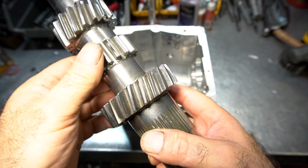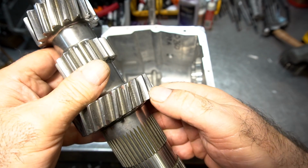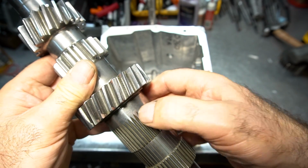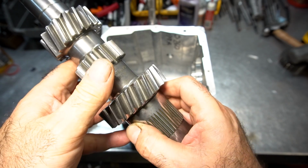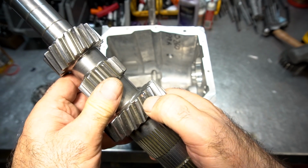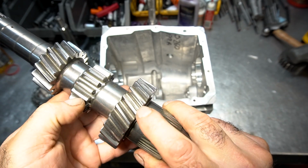One of the problems with companies that manufacture gears is they're really quick to shot peen and polish gears, but they forget to deburr them. And I don't know if you can see this clearly, but there's actually little raised edges over here that the polishing is not going to take out. They're very sloppy with their workmanship. They tend to bang a lot of the gears up and then do all this prep work, but you can see here this tooth has got a bit of a raised edge on it over here. And if we go around here some more, we'll see some other teeth that are a little bit banged up. You can see this one over here has got a good shot in it.